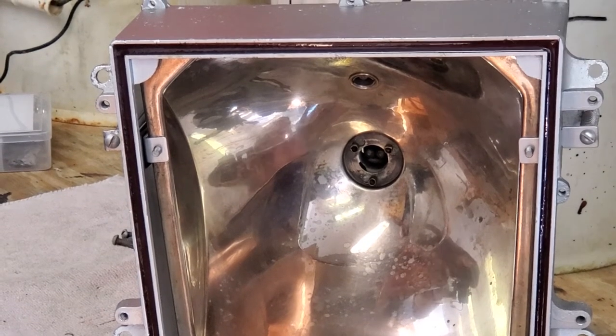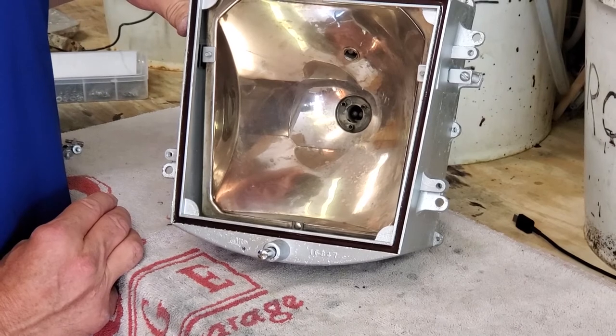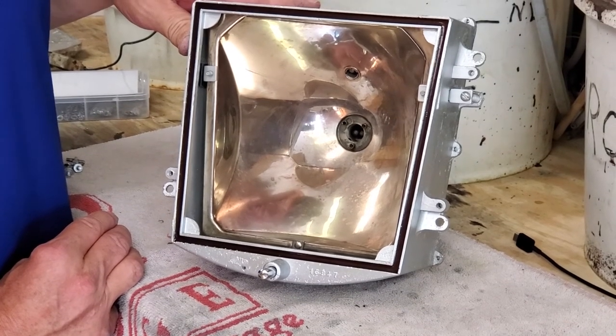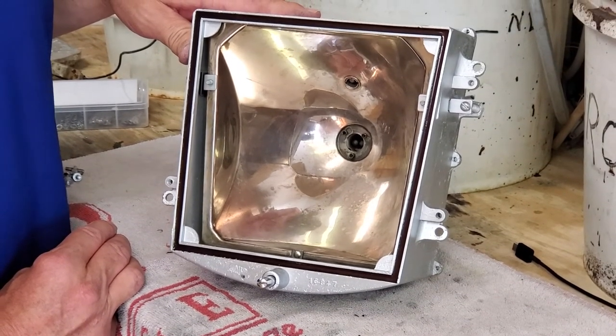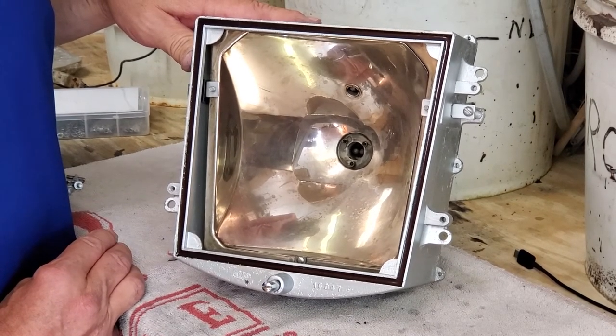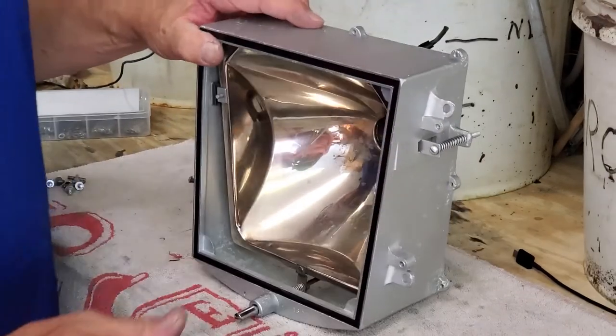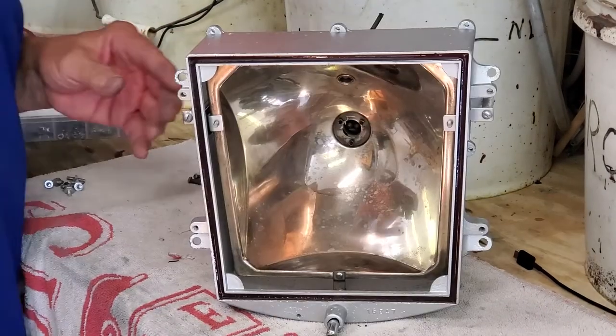Big thing to remember: this reflector needs to be re-silvered. If you're really putting this together with a re-silvered reflector, wear gloves — because it is a first surface mirror, your fingerprints can ruin it and be very hard to remove without ruining the first surface mirror. Because this is not a good reflector, I'm not wearing gloves putting it together.